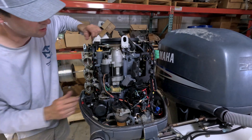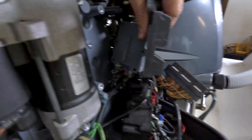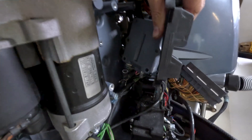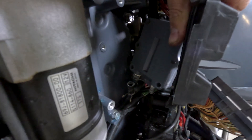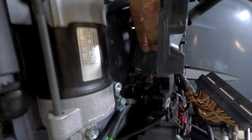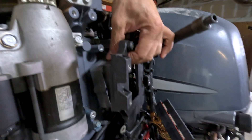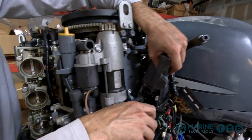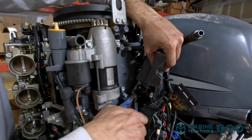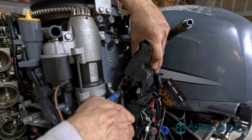There are a couple of hose clamps holding the cooling lines on and then some battery cables. I got one of the coolant lines off and there was quite a bit of corrosion in there — you can see the other one too, so a lot of corrosion right there at the connection. Going to end up pulling this whole rectifier regulator out so I don't cut my hand wide open and we can do a more thorough job cleaning it. Pulling this coolant line off — lots and lots of buildup.